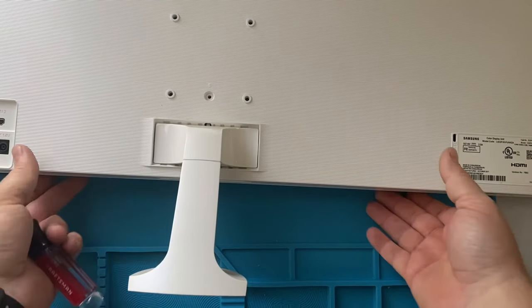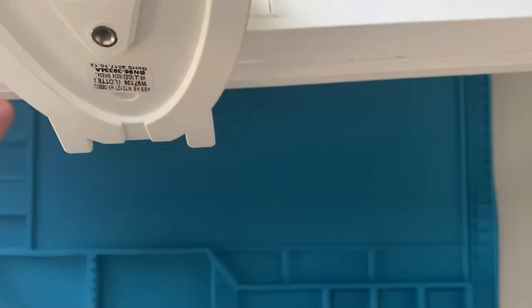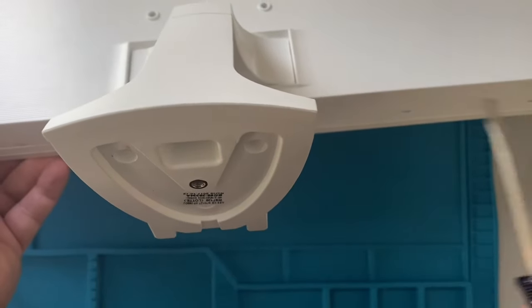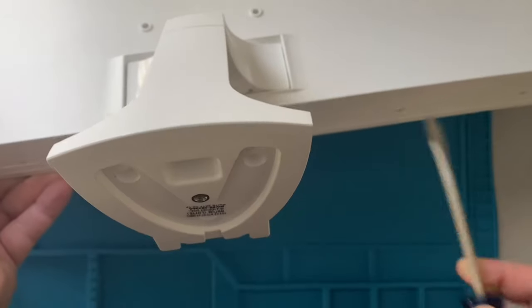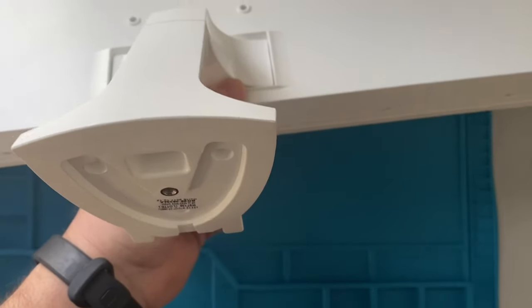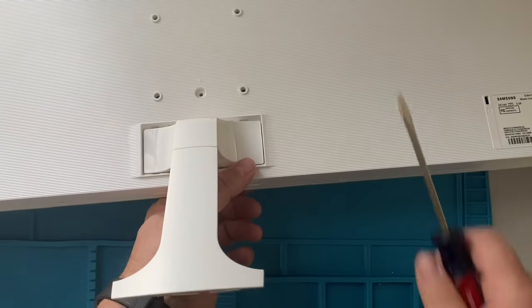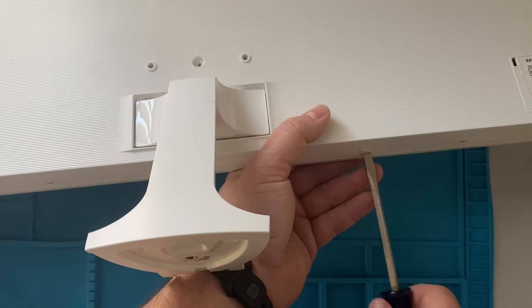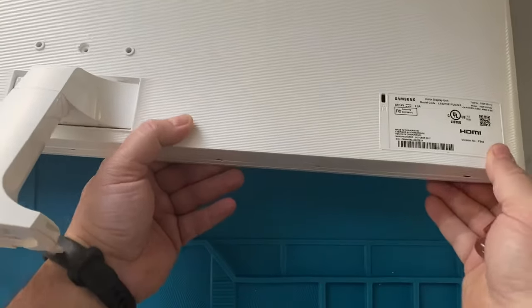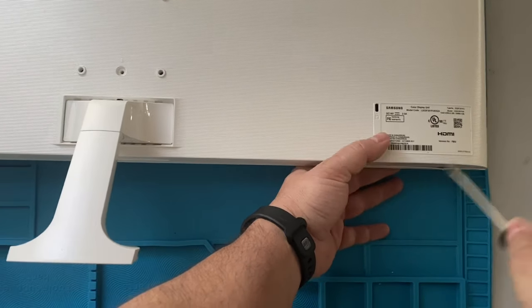Unfortunately you have to separate plastic, so I'm going to try to get this in frame the best as possible. If you look underneath here, there are these little indentations that a normal screwdriver will fit into. What you're going to want to do is depress and pry up. You're going to mar your edge a little bit — there's really no way around doing that unless you have specialty tools. This is on the bottom of my monitor; I'm never going to see it. The name of the game is to take off this white plastic piece here. I'm going to go through and start to separate — I'm pushing down and then popping up, starting in the corner. You're going to go down, just kind of wiggle the screwdriver and you'll hear it kind of click.